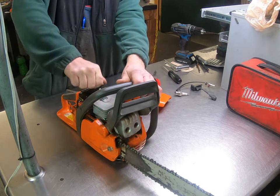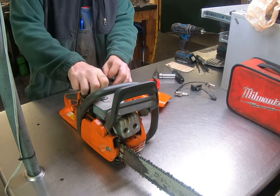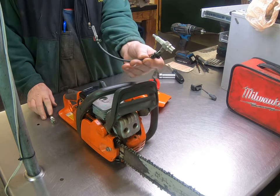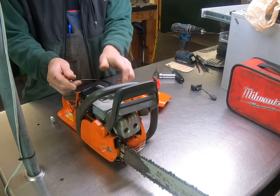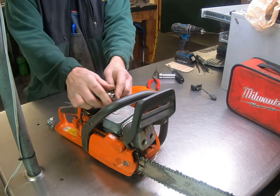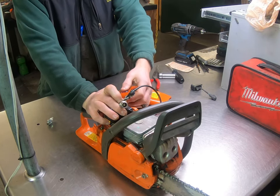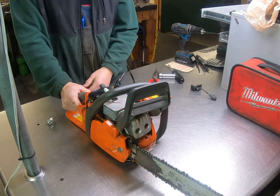If you think it might be an issue with the electronics, and using a high output tester spark plug — you can see that there, it's a very handy tool. I've got a ground strap on mine, makes it easier to ground out. See the blue snapping fire? That's telling you you've got good fire, so you're back to checking other things out.